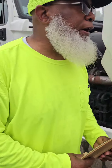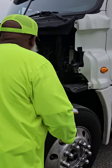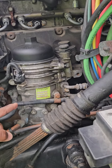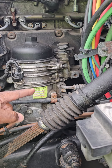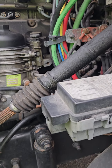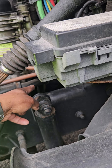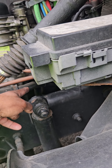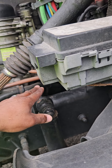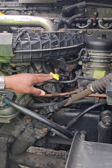On the driver's side, I have the air compressor and lines. They're not cracked, not broken, and secure. No leaks. The lines are not dry or frayed — properly clamped. It's gear driven. Underneath the air compressor is the steering pump. You can trace that hose — the lower hose goes to the steering pump. It's not cracked, not broken, and secure. The lines are not dry or frayed, have no leaks, and are properly clamped. Also gear driven. The engine oil dipstick is not cracked, not broken, and secure. No leaks.